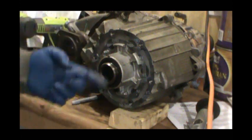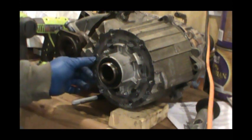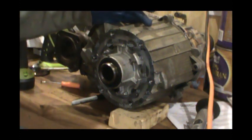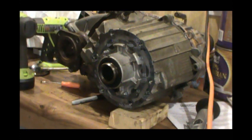You could go on the other side and put a thin layer on it, but I think I'm going to do that to the adapter, not to the gasket. Let's go get the bolts for this and get set up over at the truck frame and try to get this thing slid on. Remember, this empty weighs about 70 to 75 pounds so it is a handful. I've put them in by myself before so I'm not too concerned. Also note: I've already installed the skid plate — it's a lot easier to do before you put the transfer case in.